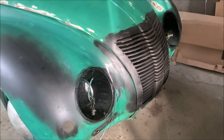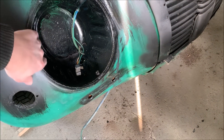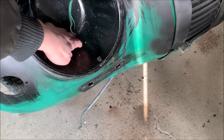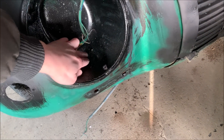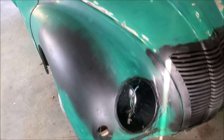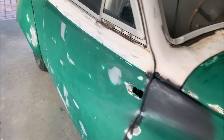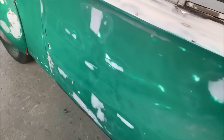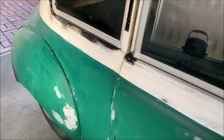At the front, I already painted the grille and also painted the inside of the headlights with anti-rust paint, because it was very rusty inside. I also drilled a hole so that if water stands inside again, it can just drain out. I rubbed the whole body down, fixing a lot of the dents — either hammering them out or filling and rubbing over them — so everything should be nice now. Let's get this car painted.